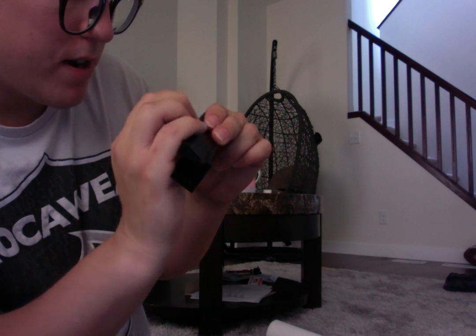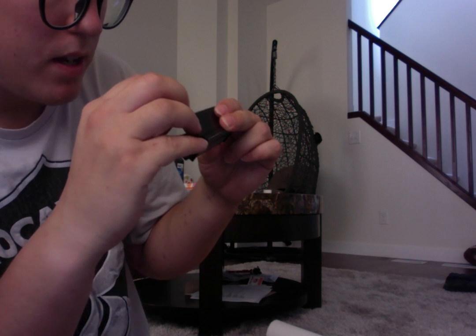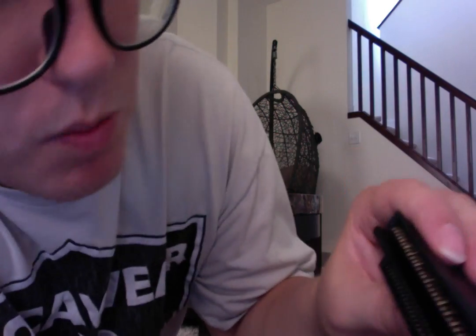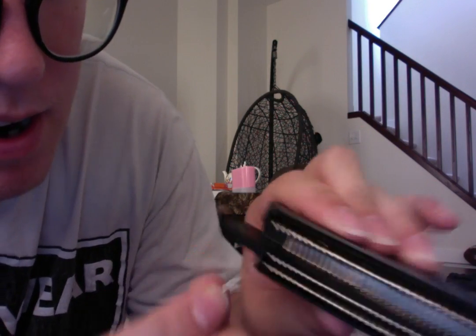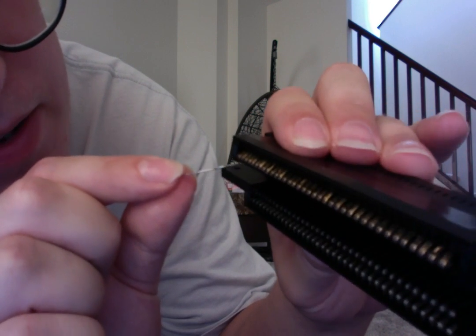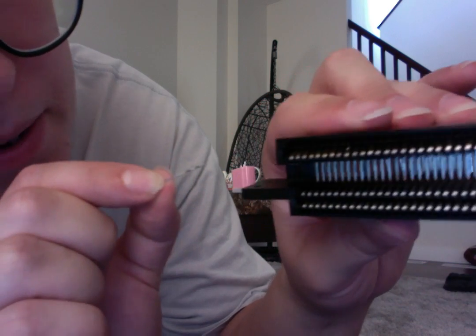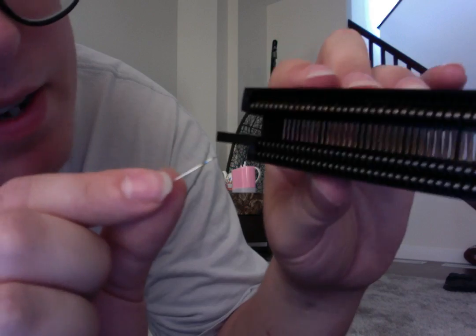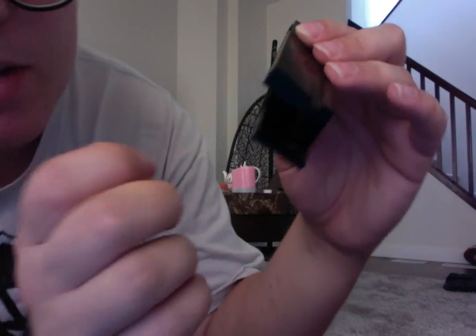You want to very, very finely and very, very carefully flick these up. So here's one that's a little bit down. I'm going to show you. You always want to make sure that these pins are up, right? Here's one that's a little down. If I can, I'll take the needle and just lift up. See, that's a little bit better. As long as you have them totally up as much as you can, that gives a good connection to the game to make it load up quicker, right?